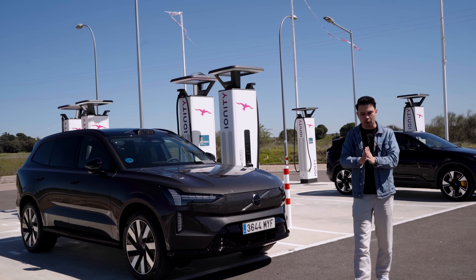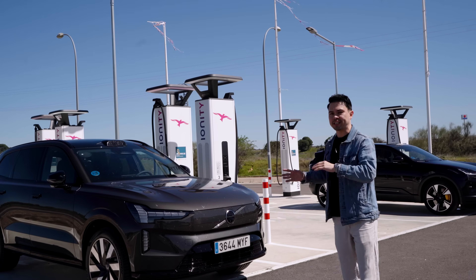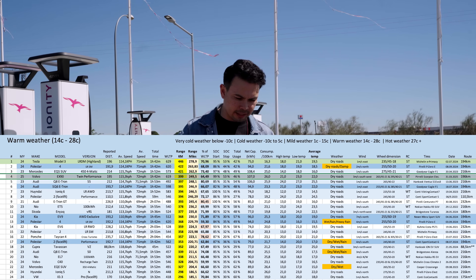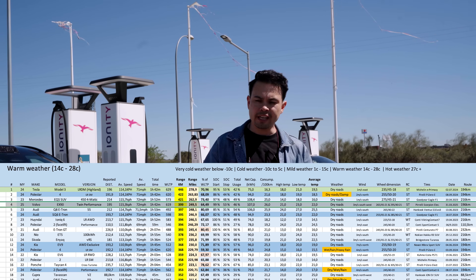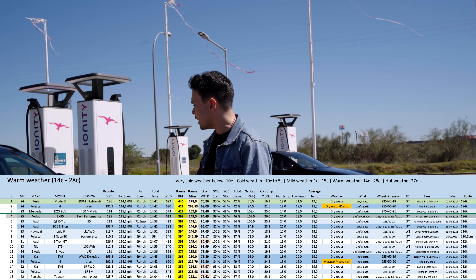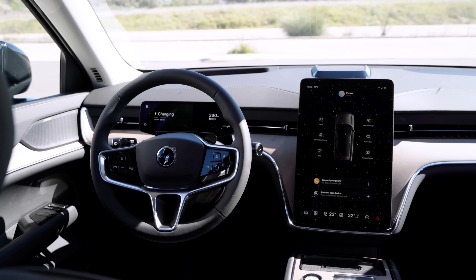Let's take a look at the results. We take the usable battery capacity — 107 kilowatt hours — divide by the battery consumption of 26 kilowatt hours per 100 kilometers, then subtract 3% for heat and discharging losses. That gives us a theoretical range under today's conditions of 399 kilometers. That's a real-world range of about 400 km in a three-row, seven-seat, large and luxurious boxy SUV — weighing almost three tons, high off the ground, with big wheels and three rows of interior room.